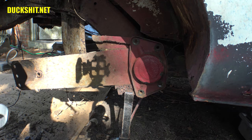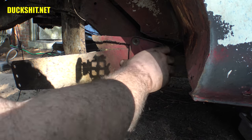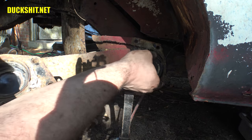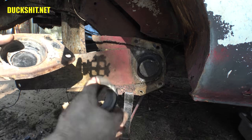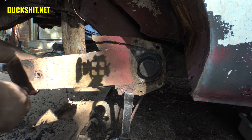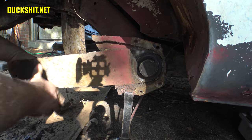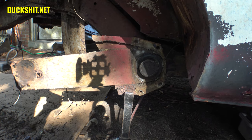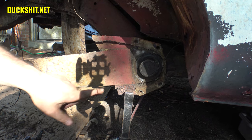Okay. This plate should come off. Here it is, this rubber bushing should also come off. Take these and put them away. Now this whole spring plate needs to be unloaded and removed. Wow, I can almost do it by hand. It needs just a little bit more force than what I'm capable of putting into it from this angle. But it needs to be lifted over the bottom stop.